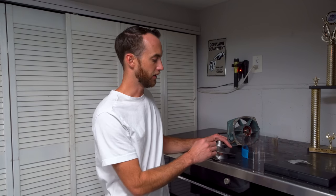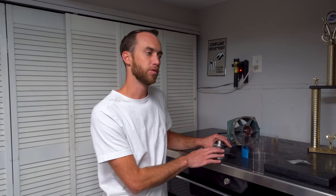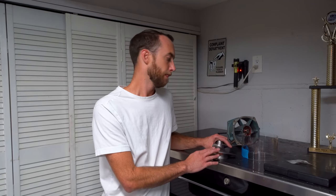If the leading edge pitch is too high, bring that number down one or two degrees and try again. On the other side, if as soon as you hit the throttle the jet ski is just revving up freely — and you know you don't have any air leaks or anything stuck in your intake track — then you probably want to make it a little steeper. So instead of, let's call it a 10, move that up to a 12 and see if it stops the over-revving. There are a lot of other things you can do to fine-tune as well.